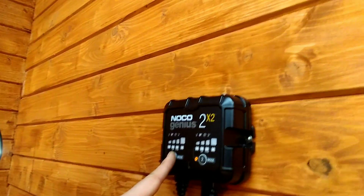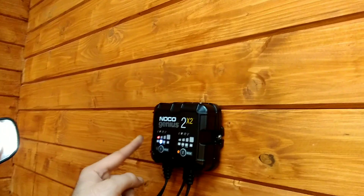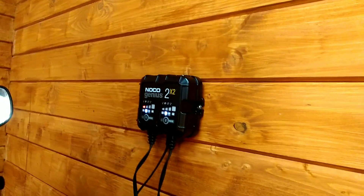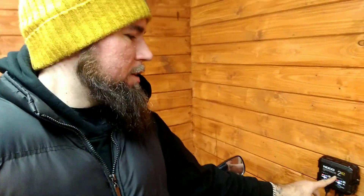I'm going to flick on the power at the socket, and it immediately flashed to let me know it was on. I know these bikes have 12V AGM batteries, so I'm going to press the mode button - past 12V standard, along to 12V AGM. This is only operating the first bank as you can see. It's pretty low. Second bank, far side - again, 12V standard, along to AGM. Again pretty low. As it registers the charge in the battery it may pick up. These are percentage marks - 25, 50, 75, and 100.